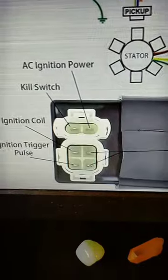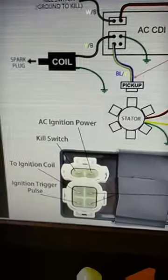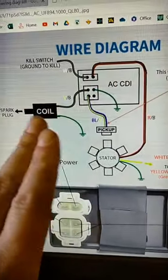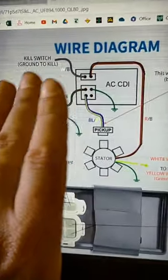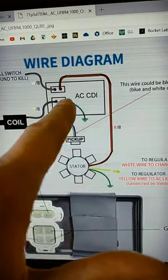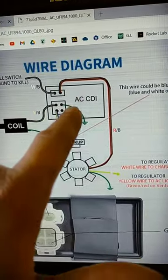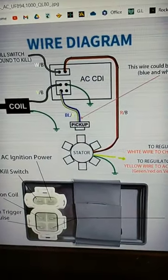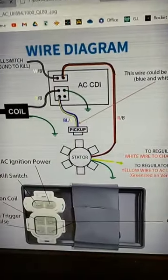This CDI has an earth — that's a standard CDI. This is the main difference you need to change when you put on the racing CDI available from AliExpress. The main difference, as I explained in the earlier video — which was hard to understand if you didn't understand electricity — is that the earth comes down through the coil on the AliExpress CDI. On a standard one, you go down to earth. On the AliExpress CDI I have, this is not a fuse, it's an earth — you put 12 volts from the ignition to here instead.